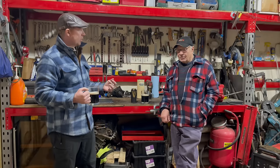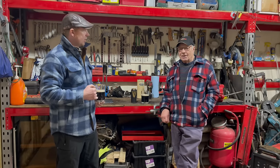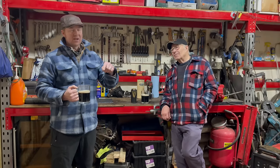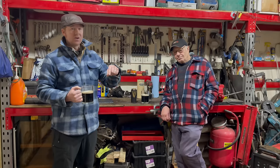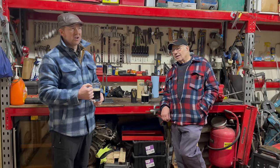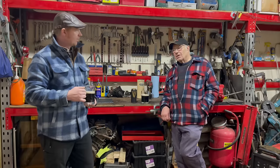Then, give it a try out on the road and let's see how she goes, how it performs. Then we'll find out what else is wrong with it. I'm sure there's loads. The biggest thing, I suppose, at the minute, which we're worried about, as you've probably seen in that last couple of shots there, is that the system's pressurising, and it is overheating, it's getting too hot. And it's weird because I think it's probably the thermostat that needs changing, because if the pipes are getting hot, it seems to be circulating.